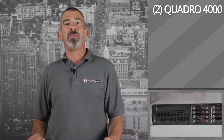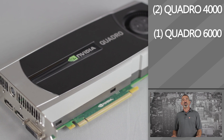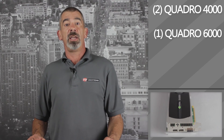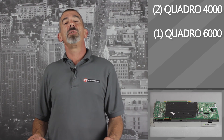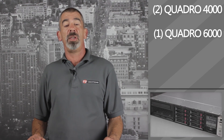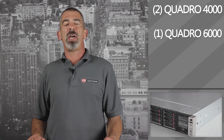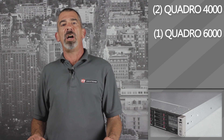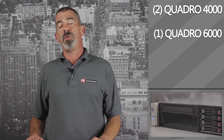Note that riser 2 requires a second processor, and each Quadro 4000 card requires a 150-watt PCIe power cable kit. Also, the Quadro 4000 option kit is not supported in the 12 LFF and 25 SFF configurations. The DL380P Gen 8 can support one Quadro 6000 card in an x16 slot in riser 2, again requiring dual processors. Installation of the Quadro 6000 requires an HP DL380P Gen 8 double-wide graphics riser cage kit, which includes a power cable along with the riser. The Quadro 6000 option kit is also not supported in the 12 LFF and 25 SFF configurations.